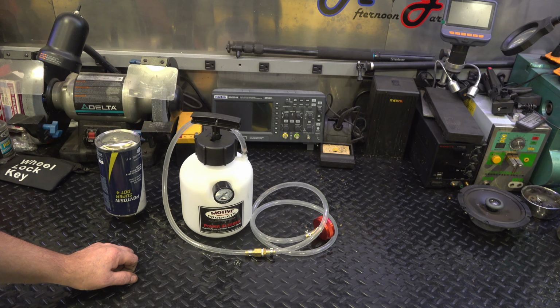So it's right here. And it's all over. And that's not good. I'll have to clean up the floor in a hurry. A few moments later. Alright, I found the leak. So it's this line up here. I thought this was to get any spilled brake fluid out of here, but that's not really what it's for. So it's basically just if it's overfilled. So we're gonna have to cap this off. So we'll do that.